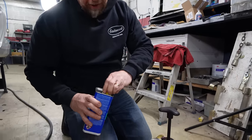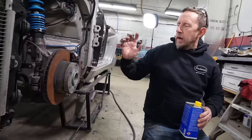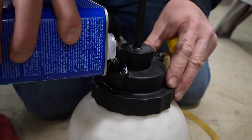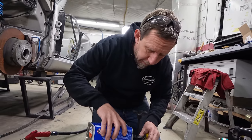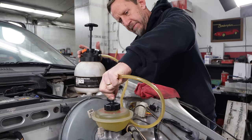If you don't have one of these, they are a game changer. It's a pressure bleeder. You fill the brake system under pressure — all the fluid's going in under pressure. It's great when the system's been opened up a lot and you've got a lot of air in there, especially with clutches because they're a royal pain to bleed. And you only need one guy to do it — you don't need somebody pumping the pedal. This is a really small opening to do it that way. When dealing with ABS systems, this is a must-have — some of them require this for bleeding. Tony, your lines are dripping because you didn't torque them down yet.